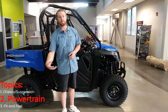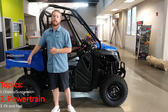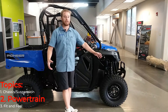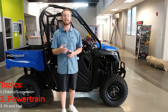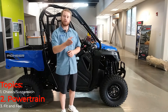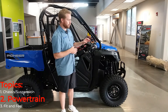As the power goes through that 520 motor into that five-speed transmission, you've got a two-wheel-drive and four-wheel-drive system that Honda does a great job with. This has a locked rear diff, and when you select four-wheel drive it has their Trax Lock front differential — a limited-slip differential. In two-wheel-drive mode with the locked rear diff, you get that tail-happy nature that makes it really exciting on gravel or hard dirt. In four-wheel drive you still get good steering feel without too much plow, and when you need all that grip in dirt, mud, or snow, this setup delivers.